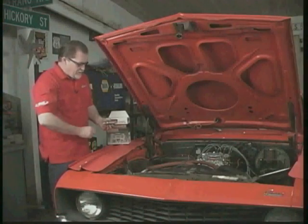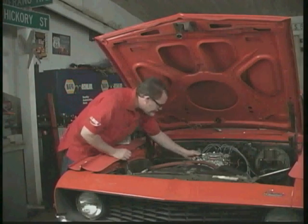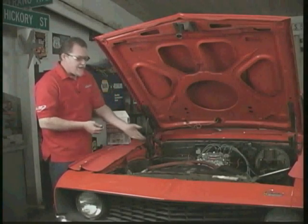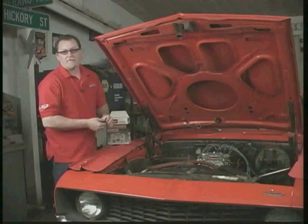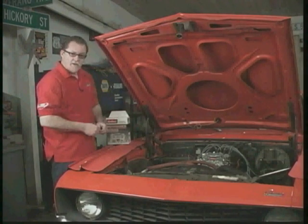The trick is, you don't want to try and take a 5/16ths fuel line and shove it on the carburetor as hard as you can. All you're doing is ballooning it out and you're just asking for a fuel leak. Fuel leak and a hot exhaust don't mix real good — you're asking for a barbecue. So make sure you're using the right size fuel lines for your vehicle.